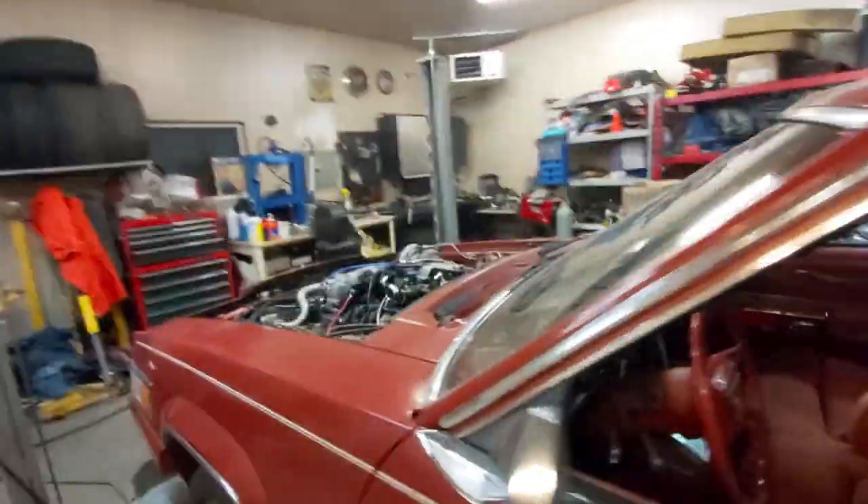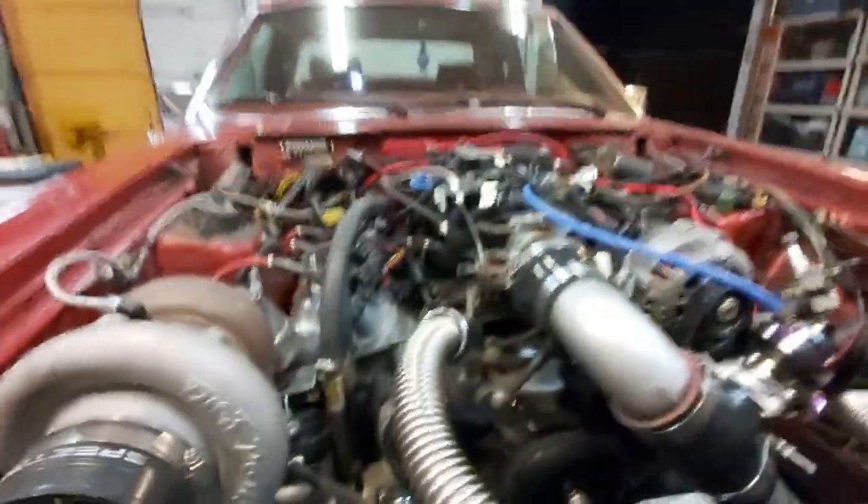The coolant has circulated, so that's good. The radiator hose is warm, so coolant is flowing into the radiator. It's not airlocked anymore. The thermostat has opened, so that's good, and there doesn't seem to be any leaks — so that's awesome.